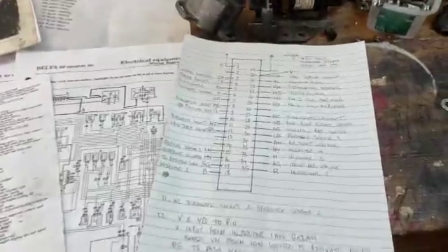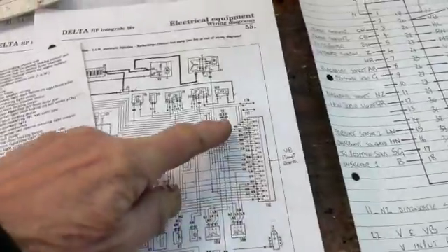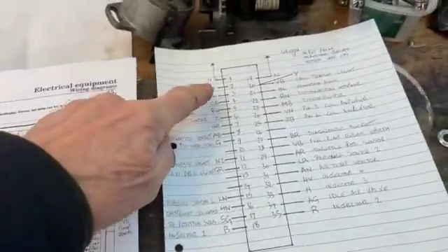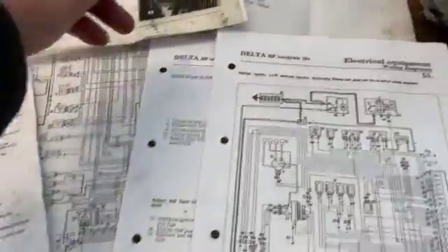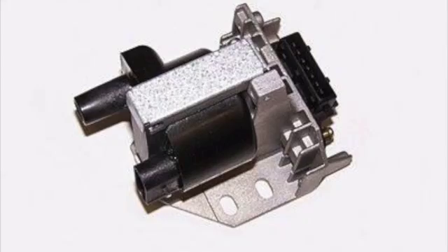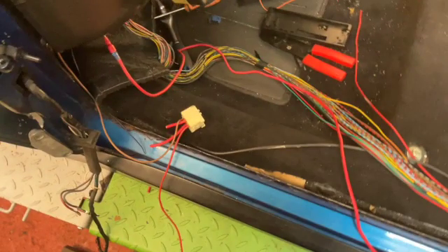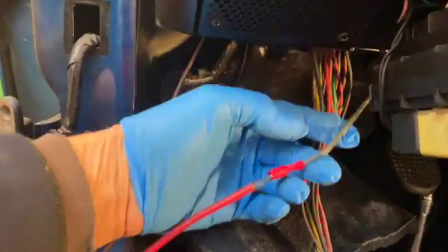Using a Berliner Sportivo wiring diagram, I made a drawing of the ECU plug with a note of where every connection went. We fitted a standard coil, then Dave and me traced the continuity of every connection, but we could get no spark. A second fuel pump relay had been fitted, switched by the original. I removed this and linked in the original grey wire.